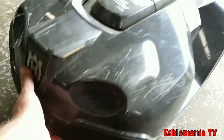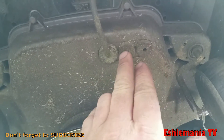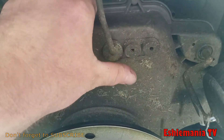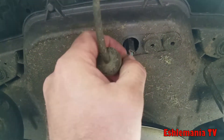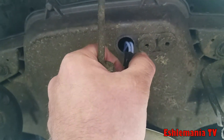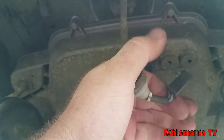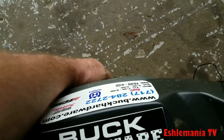The next step is to lift the machine up from the front. You can see underneath — on a 450, all three of these would have wires going through them, but we're dealing with the 430, which has only one wire. No matter which model you have, you want to pop the grommets out. Just grab a hold of it with your finger and pull it out — it's just a big heavy-duty grommet. The wire connector is back there. Just pop them out, get to the plugs, and disconnect it. Once that's disconnected, sit the mower back down and unsnap the body off of the joystick sensors — give it a tug in the front, a nice tug in the back, and pop that up off of there.